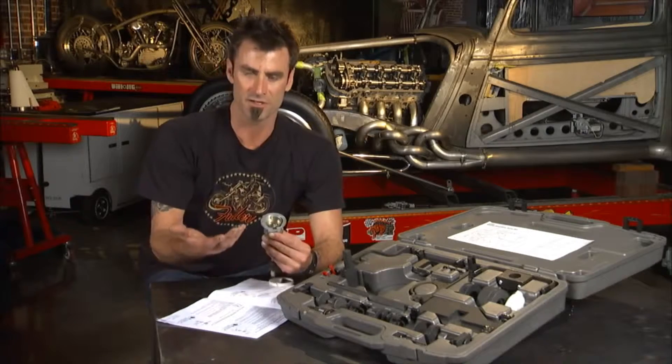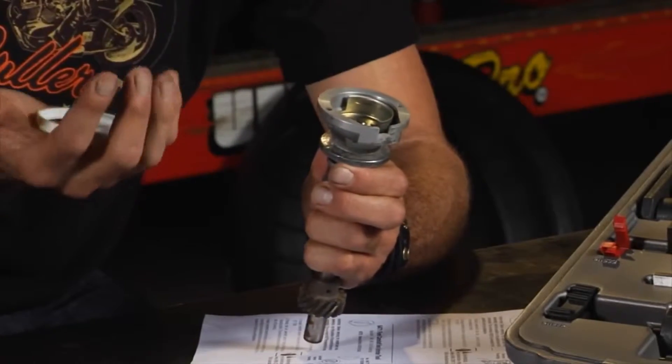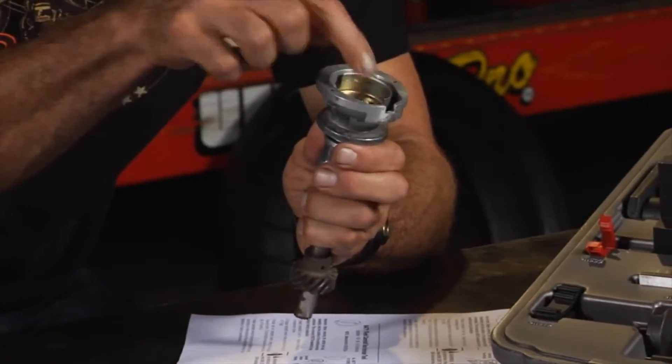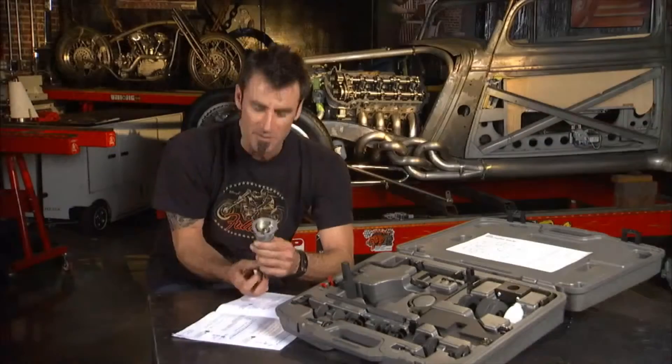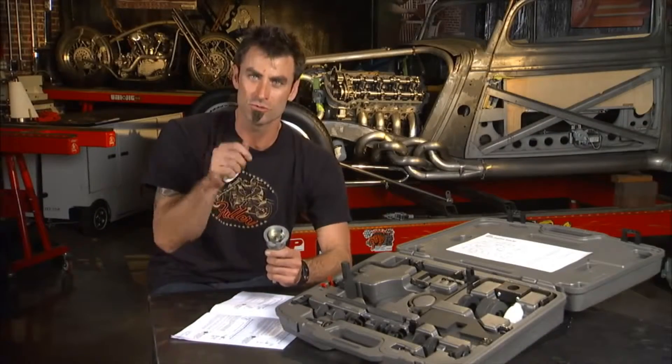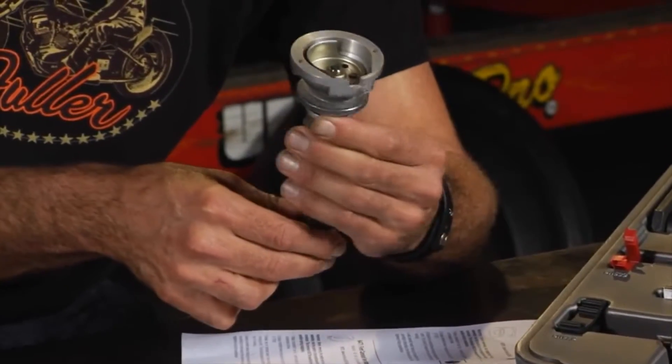Just while we're here, let me show you how it works — this works off a magnetic signal. Old Harleys did this. There's this space, and every time it comes around: I see you, I don't see you, I see you, I don't see you. Every time it does that, it's sending a signal to the computer in order for it to time the engine. If this is off, you're going to be in big trouble.